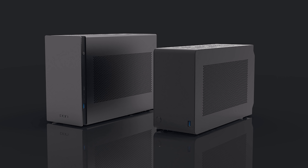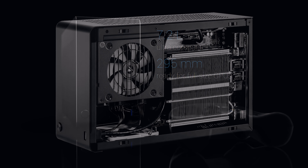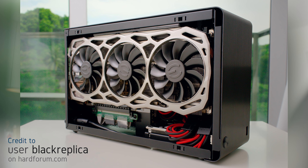The C4 SFX is an expansion on the A4 SFX, which is a tiny 7.2-liter enclosure that some of you are probably familiar with. It can house a full-length two-slot GPU up to 295mm and a CPU cooler height up to 48mm. There have been some amazing builds in the A4 SFX, but the main reason I didn't buy one was the restrictive CPU cooler height of 48mm — it doesn't leave you with many options for a powerful CPU. If I wanted to run something like an i7-8700K, overclocking would just be completely out of the question.